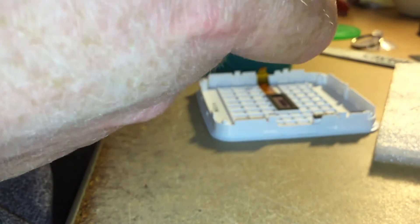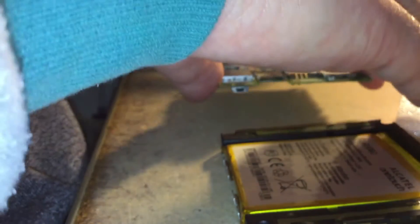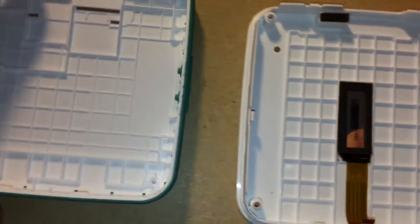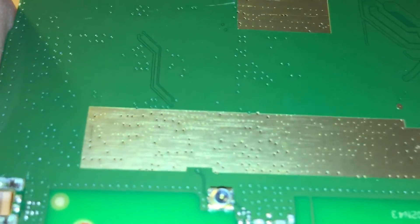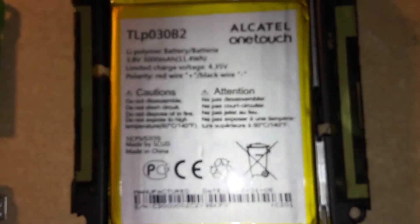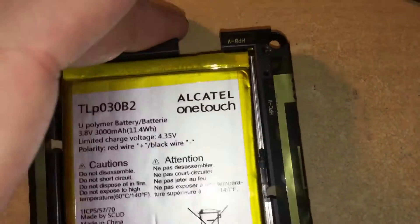Let me line up all the parts for you so you can see them. I'll do a final shot then we'll end the video. So you have the bottom casing with the rubber, the top casing with the AMOLED display and the flex cable and connector. You've got your main logic circuit board with the screening pads underneath, with the via stitching — via stitching is where they get the copper planes and stitch them together with vias, which are these little holes here which are plated through, to increase the grounding integrity. And there's the battery mounted on a plastic chassis with the 3G/4G, maybe 2G, antennas on the other side, with a battery connector under there.